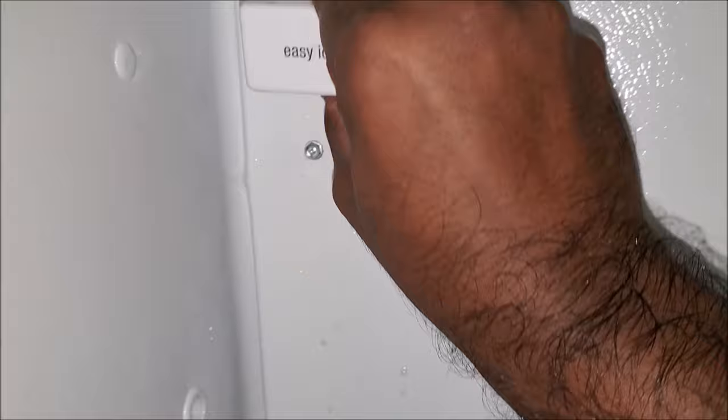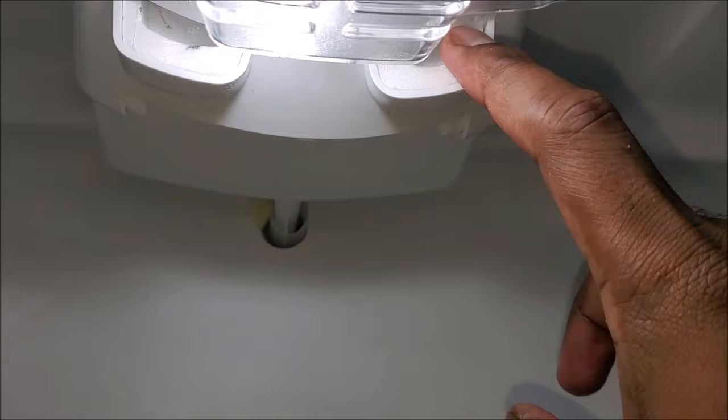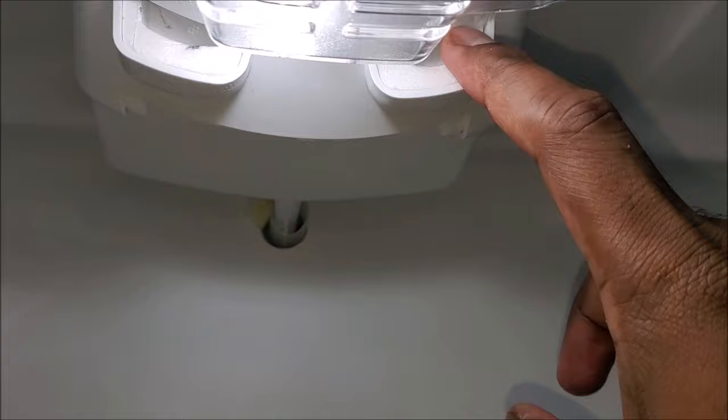Finally, put this last piece in — it goes right down, nice and easy. You can literally hear the fan blowing, and if you come down here you can feel the cold air coming out. That is the important part — cold air flowing down here. All it is is the fan from the freezer, from the chill panel, just blowing cold air into the refrigerated area.